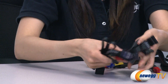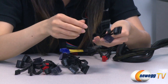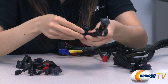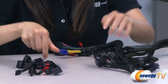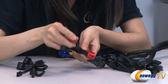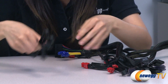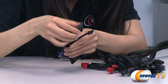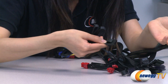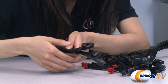Now let's move on to the 4 modular cables. First we have a 2 SATA and 2 MOLEX plugs, then 4 SATA plugs, a 6 pin PCI Express plug, a 6 plus 2 pin PCI Express plug, and lastly 3 MOLEX plugs and one floppy plug. An interesting thing about these MOLEX plugs is that they can be hard to remove — just pinch down the sides and you should be able to easily detach the MOLEX plug.